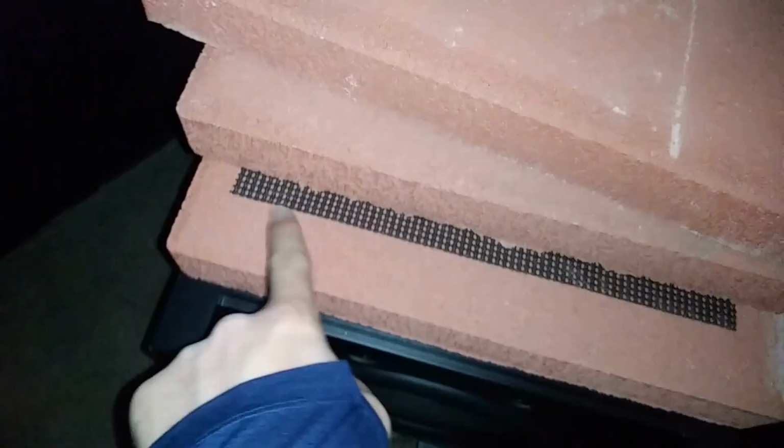The bigger subwoofers, by the way, you've got to do this to them: put this stuff in between the bricks and underneath this one, and make them staggered so it pushes the weight down on the plate amp so it doesn't rattle. They don't rattle now because of this. I could just put a black fabric over, but they have to be staggered like that. They'd look kind of cool if you put them forward and put the grill on, all uniform, but it needs to be like this to put the weight on the plate amp so it doesn't rattle. Oh my god, that's not what this video is about.